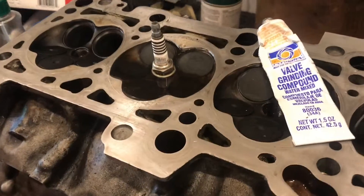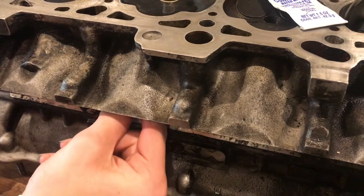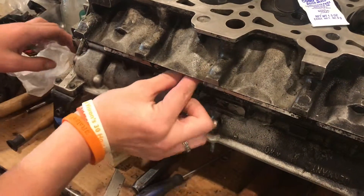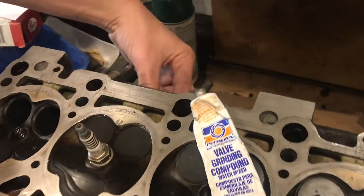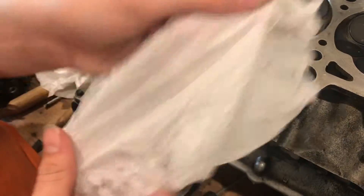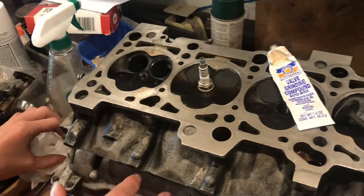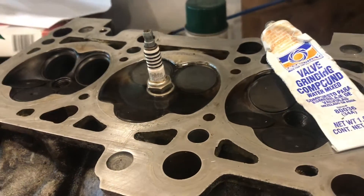It's been about one to two hours and I haven't seen the water level go down at all. I also put some toilet paper in the holes here, just so if any water drips it'll really show up on the toilet paper. And this seems perfectly dry — there's no water on it. This one right here is the same, it just seems perfectly dry. And this one — I do not see any water on it, that's just oil, I can tell. No water. So that looks pretty good. The water level is not going down at all. You can judge by the water level, or if there's any water underneath it.